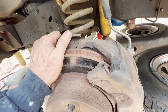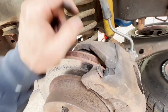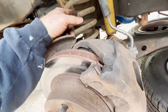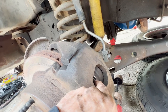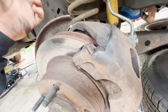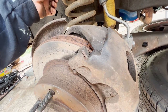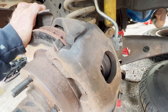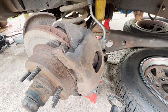When you are reusing the same calipers, you need to open the bleeders, because when you push on one side and go to the other side, if you push a piston in on one side it's going to push it out on the other. Also clamp the pistons when reusing, because that pressure — if you push a piston in on one side, it's going to push it out on the other. If you're new to this, you need to know that.